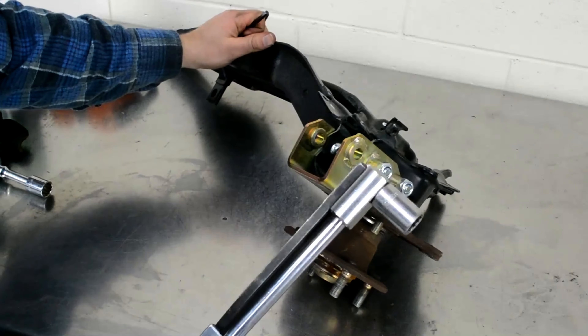Before leaving the rear section, let's talk about the brake setup. This is a custom setup I found on forums — a base model RSX caliper, an EP3 4-lug rotor, and a base model RSX brake pad. It definitely worked. My brake lines are Finishing Lines stainless steel with an adjustable proportioning valve. I spent roughly $190 shipped for the rear brake setup — definitely worth the money.